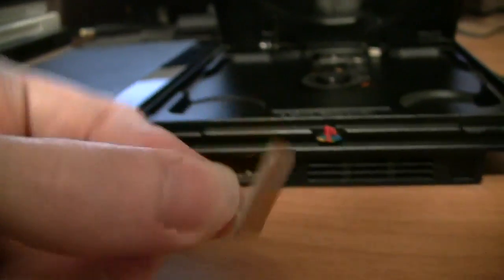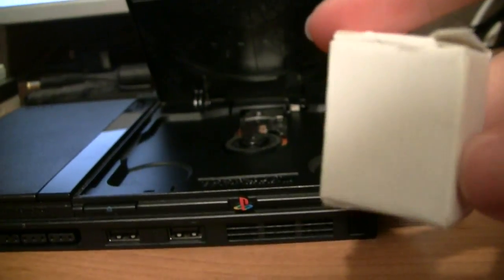So I figured out that, unfortunately, rather than this tool here, which is what you slip in the wire, this must be the PS2 that this tool was for. You're actually given more tools with Magic Switch than you need. It's very cheap, and unfortunately it comes in this little box only, and they're all very small plastic parts. But you don't need to use all of them. There's different ones provided for different kinds of PS2, and for this one, we want this square one. It's got a little opening in it on the bottom there.